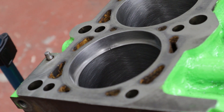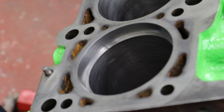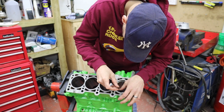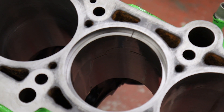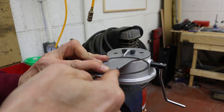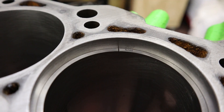Here's the thing about ring gaps: it's far better to have too much ring gap than too little, because the ring needs room to expand, and you can cause a load of damage by not having enough gap. And if the rest of your rings are alright, then chances are it'll probably not have that much of an adverse effect. Plus, it's far more important that the ends of the ring gaps are completely parallel to each other - you don't want a wonky cut.